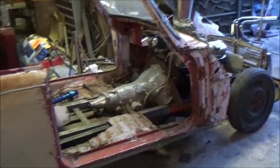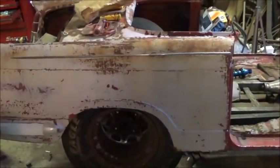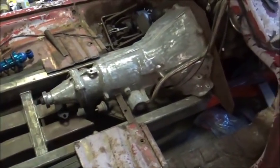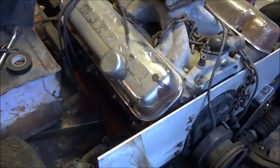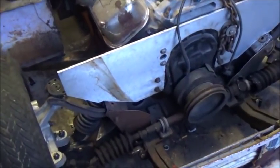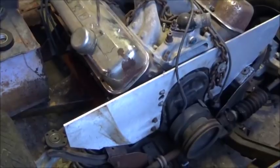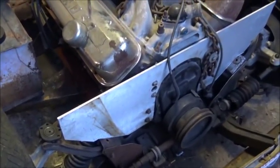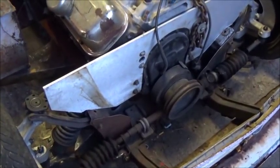The back end — I can lower it down more if I want to. I don't know if I'm going to. It's going to look pretty low anyway when we get the rocker panel on, and it should sit about like what I had planned. Like I said, the engine's got to be moved back. I'm going to make my transmission mount and get some engine mounts made so we can bolt the engine up where it needs to be. With this being underslung, that's why the frame looks so low — the frame's lower than the engine, lower than the axles. That's just the nature of the beast. Keeps your car low, keeps your center of gravity low. One of the good things is if it does come down, it will hit the frame before anything else. I don't want my suspension bottoming out before the frame hits the ground — if it bottoms out, it's liable to break something.